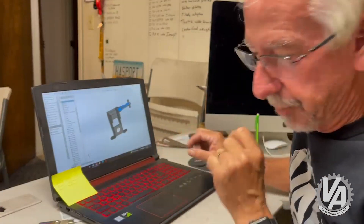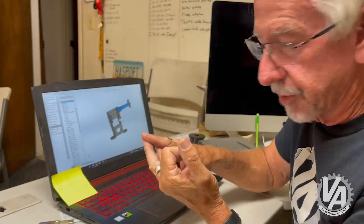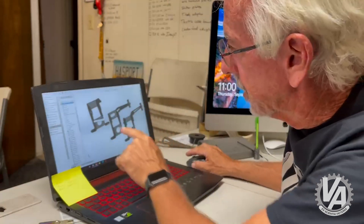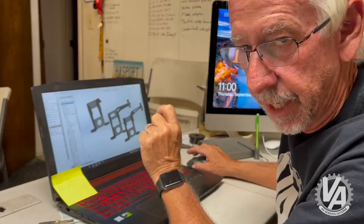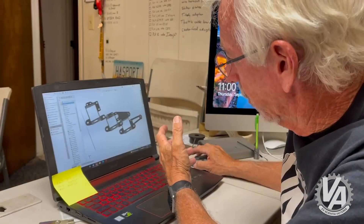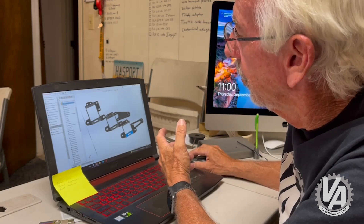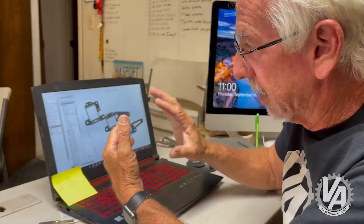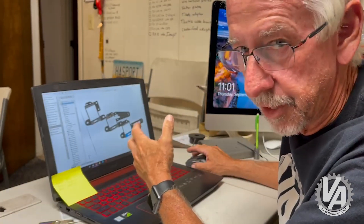Let's break away from the shop for a moment to show you how I did my design work. Basically, I have the FD stock and the FD1 stock overlaid here. We'll pull them apart real quickly — these are the three brackets. Here's our original FD stock. What I needed was these bolt hole locations in relationship to these bolt hole locations, which I then made on this new bracket. Once I did that, I needed to get some information from this particular bracket, because it goes in the FD1 subframe. I needed to know where this particular location was, and also where the holes in the back that go on the bracket to the side of the car were. So I basically overlaid my parts together and from that I was able to derive this third part that worked with our engine and our new chassis.